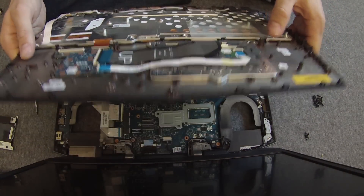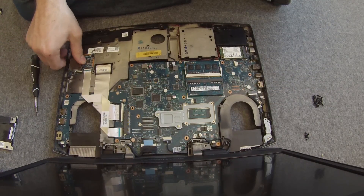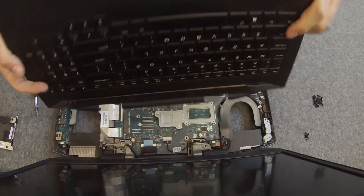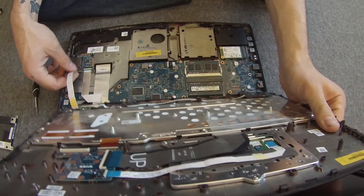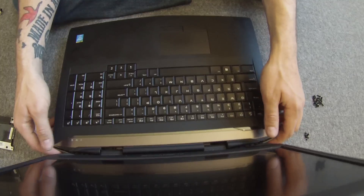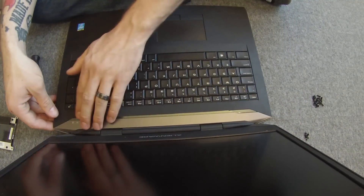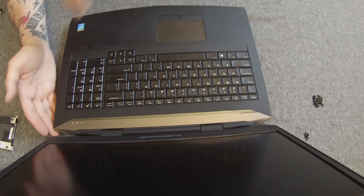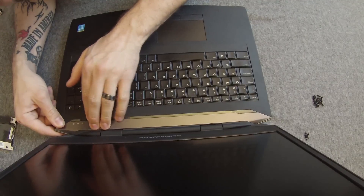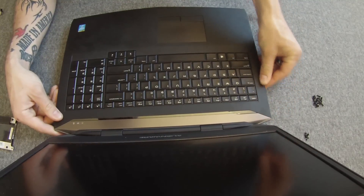Now move on to putting the top cover back on — it's very simple. While putting it back on, here is your connector for the SD card reader and here is the other connector. Just connect that in — I like to hold it up and then connect it down in here. Once connected, tilt the screen back as far as it can go because the hinges go down on it. Slip the hinges back over and check all around the laptop to make sure everything fits nice and snug, then start pushing down gently. You'll hear some clicks — those are just the plastic clips that hold the assembly together.